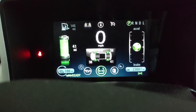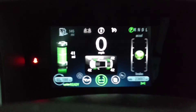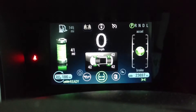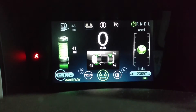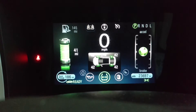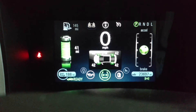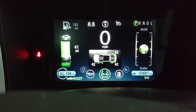I'm getting close to where I want to be. It looks like the other side of the car — the right side, or passenger side — also has a similar issue. The side of the car is correct, but not the front versus back. When I take it in, I'm going to have them recalibrate it so the TPMS is picking up on the correct corner. Last winter when I had the car serviced and they rotated the tires, they didn't update the TPMS to the correct corner.